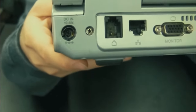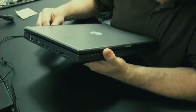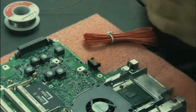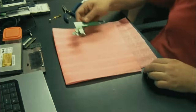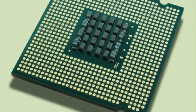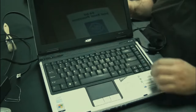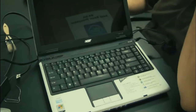Another reason the motherboard might not turn on is that it's not getting power through the power jack - the power jack might be damaged. Observe what you can from the outside to see if the power jack is loose or detached. If it's secure, the only way to test the power jack is to get down to motherboard level and look at where it's soldered on. There are a few other things that might cause a computer not to turn on: a bad processor (fairly rare - about 1 in 75 computers), or a broken power button.